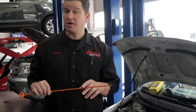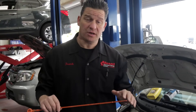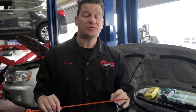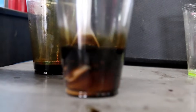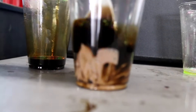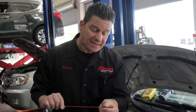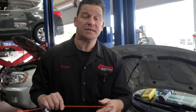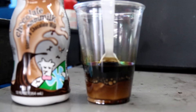One of the most crucial things to check with engine oil is to ensure it does not have any water or oil mixture. If you've got water in the engine oil, that's an indication the vehicle may have overheated. Water and oil mixing will look like chocolate milk. If you take a sample of the engine oil and you see any water or chocolate-milk-like substance, stay clear away. That's an indication that the motor has sustained some heavy overheating.